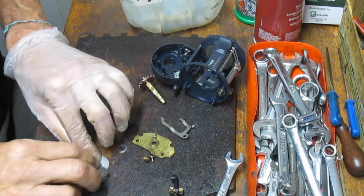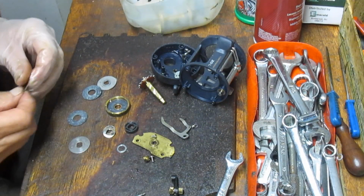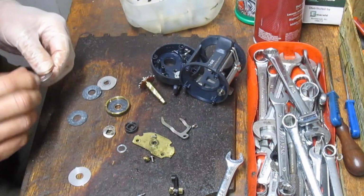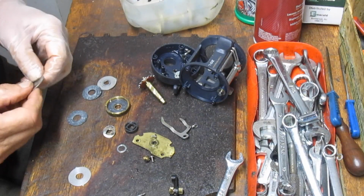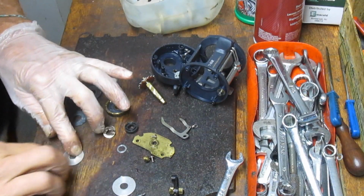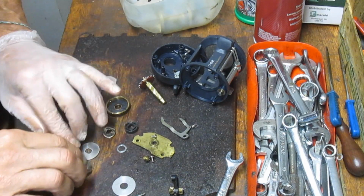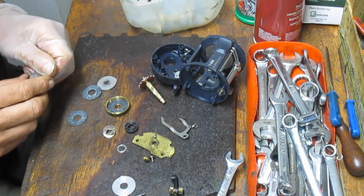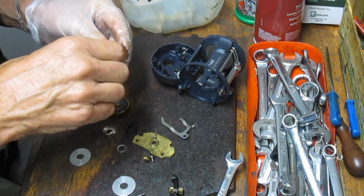This is 4-0 steel wool. Don't get any more aggressive than 4-0 steel wool. Okay, so the setup on these is pretty much the same setup that's on all of the 6 drag system. 3 metal, 3, in this case, the composite. So I'm just going to load it right back on the way they came off.